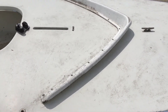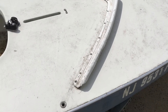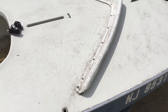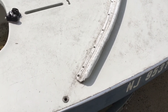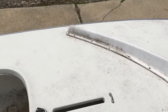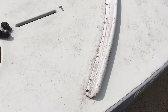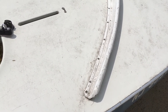What we've decided to do here is clean the hell out of the wash box underneath it — we're actually going to use a power washer to do that. Then we're going to seal the whole perimeter with 5200, put an additional pop rivet on each end, put a nice burly bead of 5200 around that whole thing, and also seal up the top of the pop rivets, because that's how water could be getting in through there too.